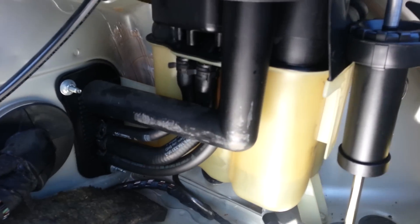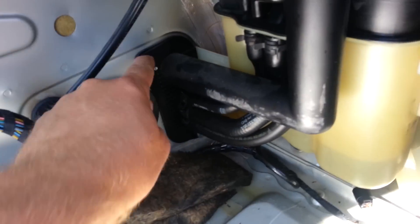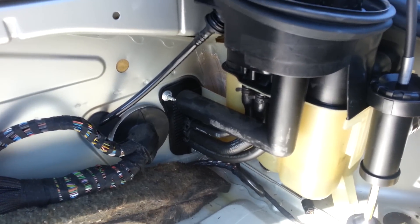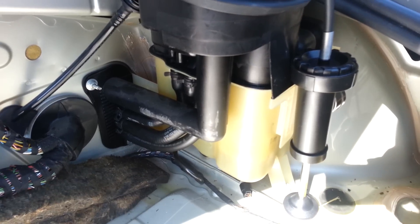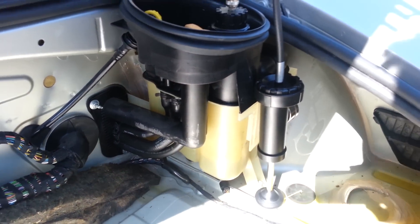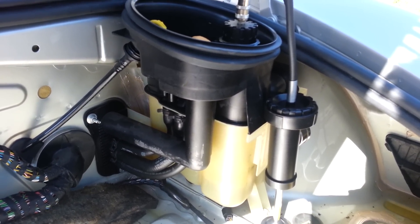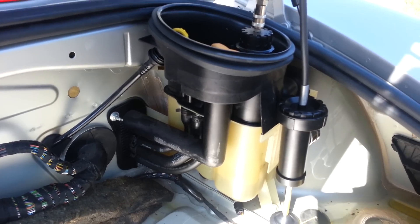Because you're going to go through a lot of trouble to replace this. It's a couple of really easy bolts and screws to release it from the framework, but back here there are actually three additional hoses with clamps on the other side of the firewall that are a pain to get at. The agony you'll go through only to put in something that might fail within a couple of months - spring for the $250 you see on eBay, get the complete brand new replacement part, hopefully the latest model. There are about three generations of this overflow reservoir and you want the newest one, which is least prone to failure.